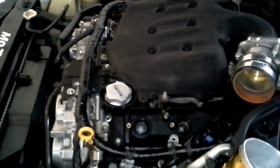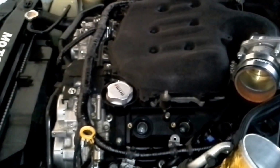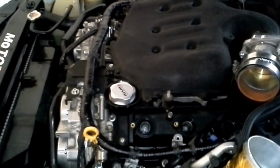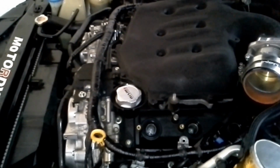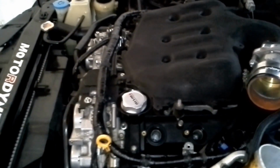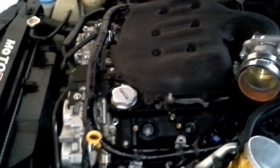And just show you the coil packs are pretty simple to replace, and hopefully that helps with your headaches on getting check engine light, random misfire, P0300, P0301, which is cylinder 1, and it repeats. So it's 302 at cylinder 2, P0304, which would be cylinder 4. So that's how the coding kind of works on that.